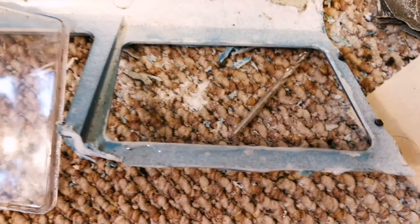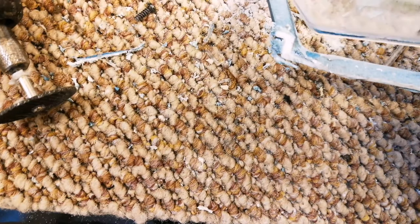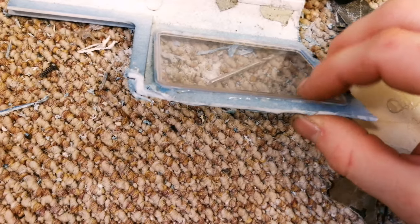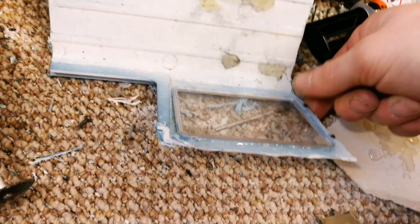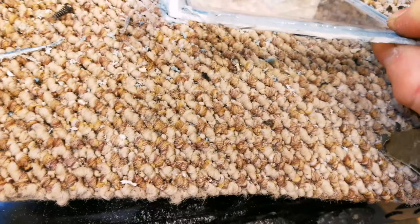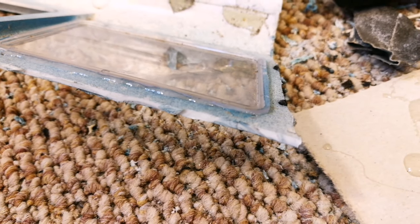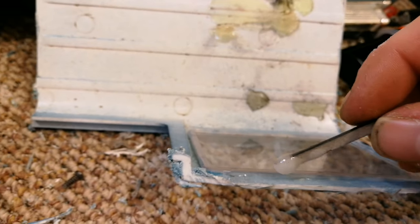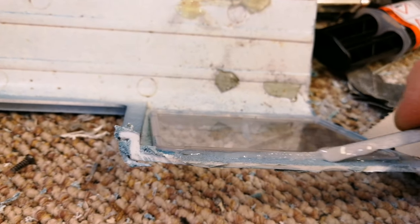Just for an example, we've got a little bead of epoxy in here. Pop your window in, make sure it's sat down in the recess - you'll probably hear it click. Then just go around and make sure it's seated properly. Get a bit more of your epoxy and do this the entire way around the window itself.